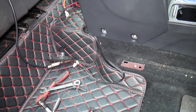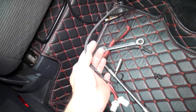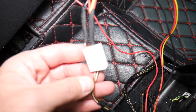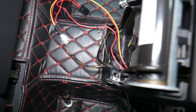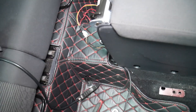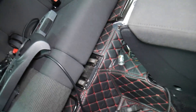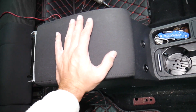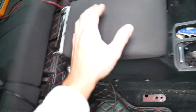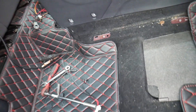The zipper is fully closed. The holes we drilled earlier have the switches installed in the center console, with wires for both passenger and driver seats. For the power source, we'll tap into the rear cigarette lighter — the brown wire is ground, the other is positive — still running through the computer and voltage regulator. The rear cigarette lighter is on a 15-amp fuse, which matches the 15-amp draw of the heated seat system. This way we don't need to run wires to the front battery, and the circuit is only live when the ignition is on.